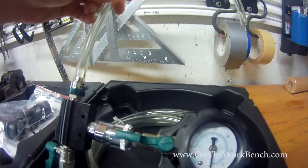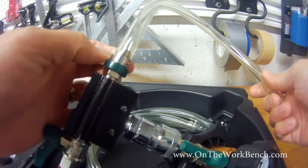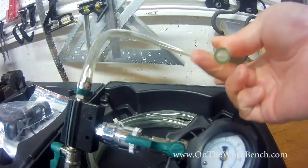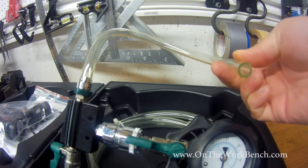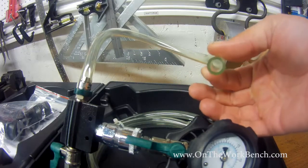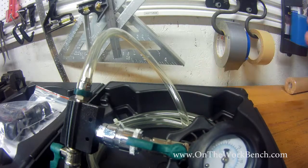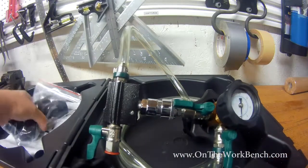One thing to note: you may actually need a longer blow-by tube. It comes with a sealed fitting already, but you can undo that clipping or add an inline valve to extend the length so that when this is on your radiator cap, it can reach down into another bucket. That way any residual coolant coming out the vacuum line isn't dropped on the ground — especially important if you've got pets. Coolant is very attractive and deadly to pets, and I'm a dog owner and I don't want my dog ever coming in contact with engine coolant.